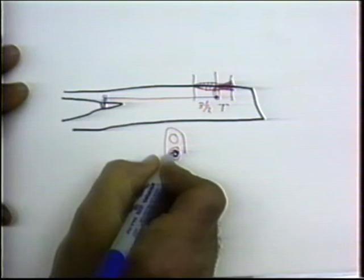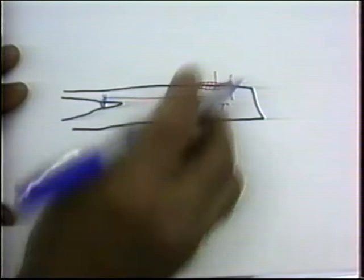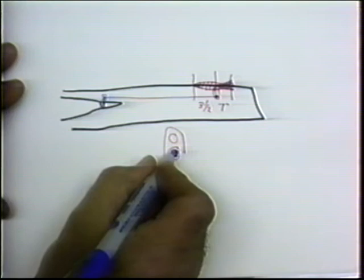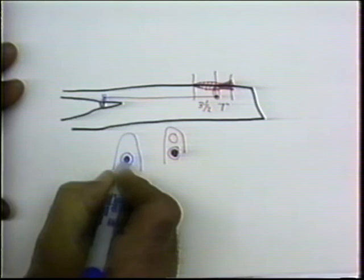Take that bushing out. After you get all done here and you're all finished, everything's in neutral, before you solder this permanently, take that bushing out and you'll have half up and half down. Now if you decide you don't want any slop in here, leave the extra bushing in. And you'll wind up with a horn that has an 1/8 inch bushing, and inside of that you'll have a piece of fuel tank tubing, and inside of the fuel tank tubing you'll have the wire coming out. So you'll have a double bushing, there's no problem.